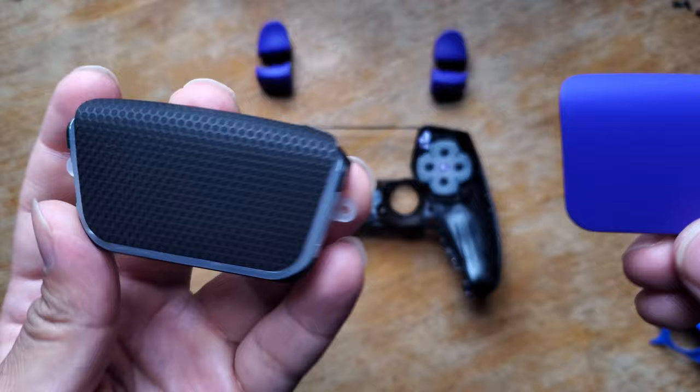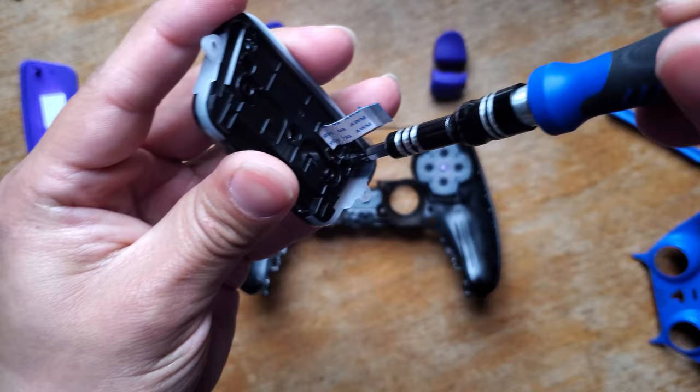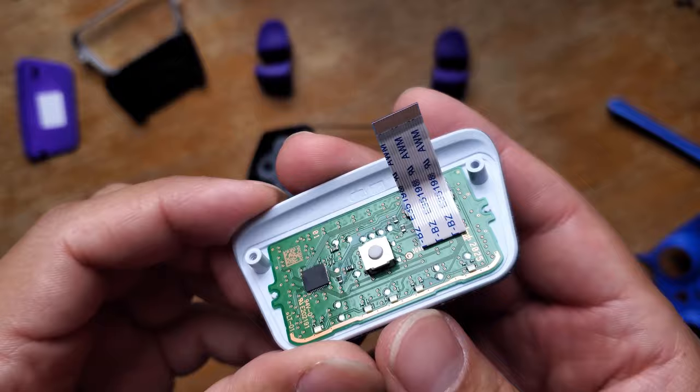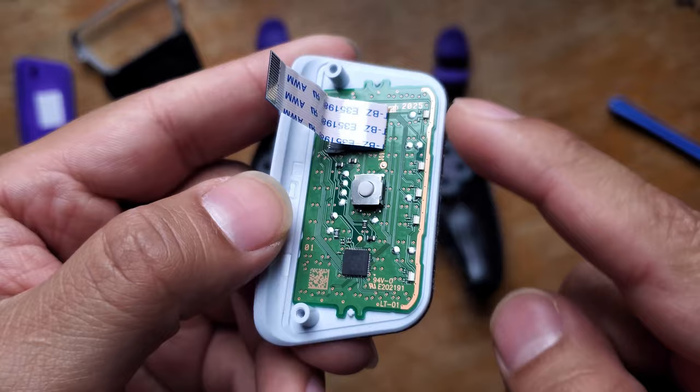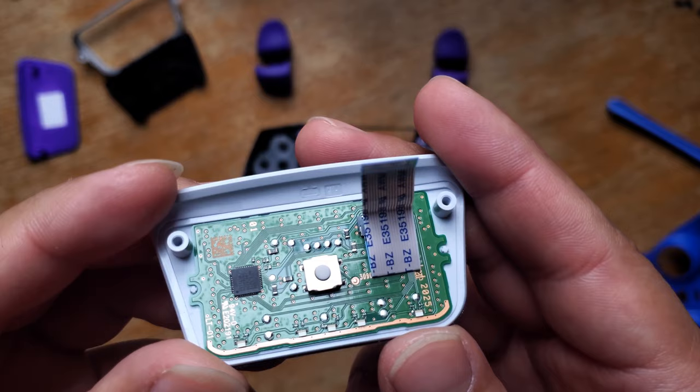Next is putting in the new touchpad. You've got two screws — one left, one right — take them out. Once you've got that out, the black piece comes out. For the next step, you're going to have to use either a heat gun or a hair dryer. You need to apply heat on the back right here — the whole point of this process is so that the glue can loosen up and you're able to remove the little board.